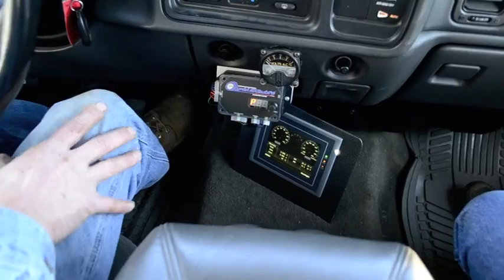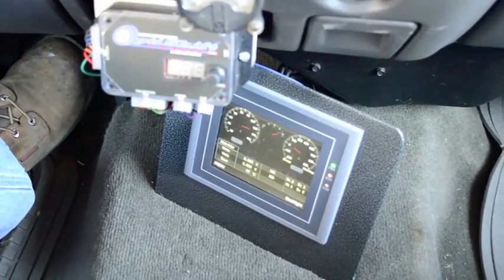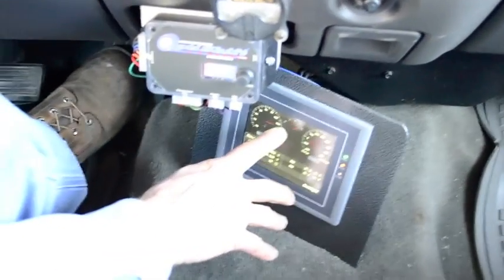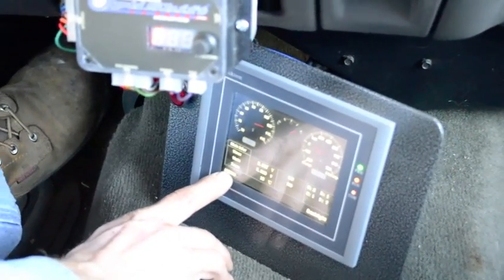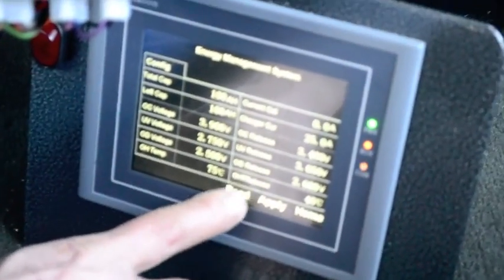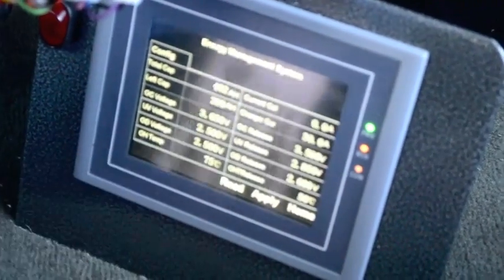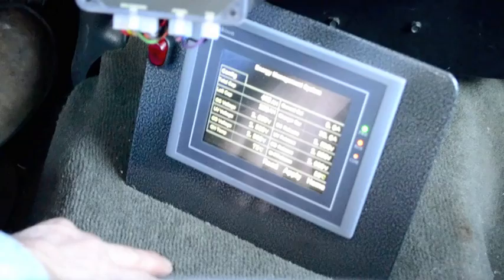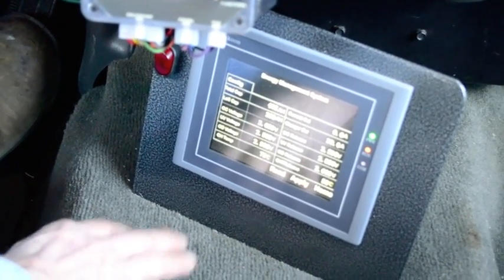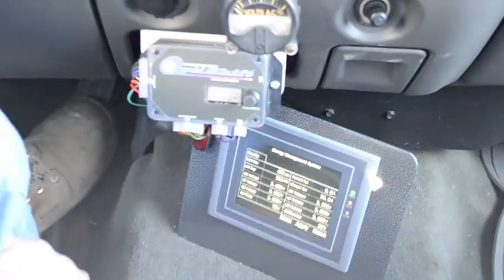This down here is actually from the Ycom battery management system that we use. It measures volts, amps, and the state of charge meter, which shows how much we have charged — similar to a gas gauge. We can go into the configure mode and read: it shows that we have 402 amp hours of battery capacity and we have 399 amp hours left of usage. This is where you go in and you can change all your over-charge, your under-voltage, your over-discharge voltage, your temperature settings, and all of that for the protection of the batteries and the other components.